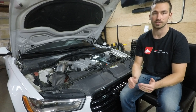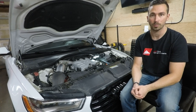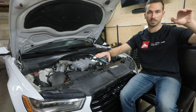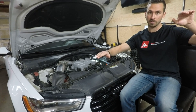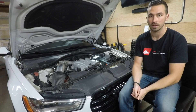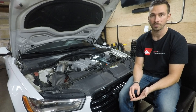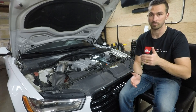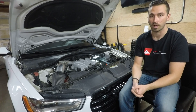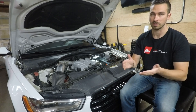Here's the important part: if there's any improvement or detriment to the supercharger cooling system, it must be measured on the IAT delta — say on a quarter mile run or a couple gear pull. You're going to take the starting temperature; it's going to heat up by the time you let off, and it's going to have the hottest temperature. Take that final temperature minus the beginning temperature — that is the delta. If that number gets smaller, your supercharger cooling loop is doing a better job at managing your IATs. Note that a second-to-fourth gear roll will actually load up the car more than a quarter mile dig, so your IAT delta will look worse on a roll. After making a change to the system, comparisons must be consistent — apples to apples.